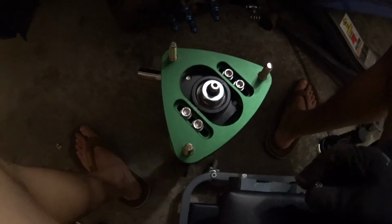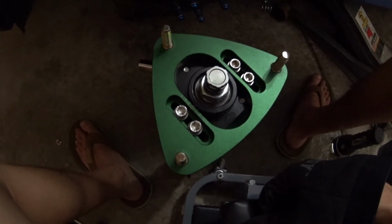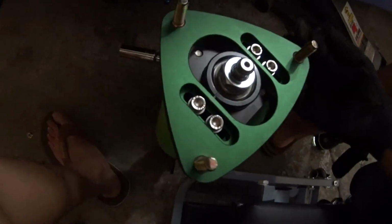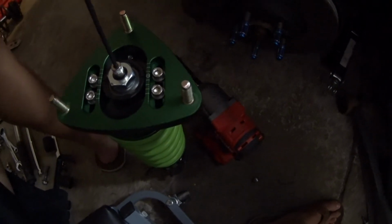I don't know. Okay, so I took a look at this damper setting on the front strut. That's what it looks like when it comes shipped to you. Counterclockwise is softer, clockwise is harder. And there's a little bolt or a little hex here, and if you take that off, this will come off. And this essentially gives you access to the damping settings. It's a little bit not snug, but this is a 3mm and it fits in here.